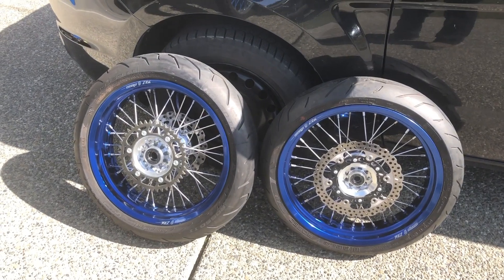My recommendation is to just buy an extra sprocket, especially if your chain is in fairly new condition, so you can swap between your two wheels easily. Once they've been on there for a while they seize up pretty good, so I recommend just keeping the 47-tooth on each rim so you don't have to change them — it's just too much work. Then take some grease, rub it all over the axle to get it ready, and make sure you put your spacers back in on the right side.